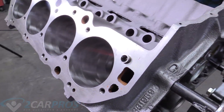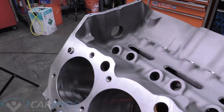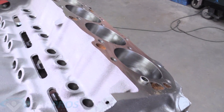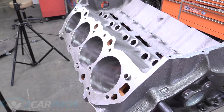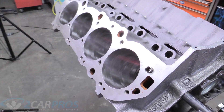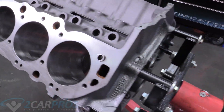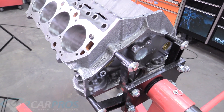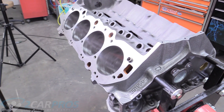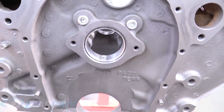The other thing I want to talk about is these dowels on each side — two for each side. If you came back from the machine shop without those, send it back, because you're going to need these in order to put the cylinder heads on. You also want to check all the threads for the heads and the bell housing bolts. A good machine shop will have chased all of those to make sure they're in good shape.